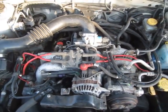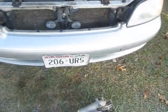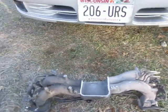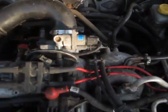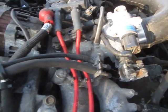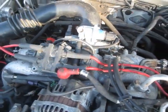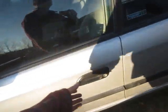And this is what we ended up with. Got a little different air intake. Had to custom make some plug wires. And the main thing was I had to take the 2.5 intake and cut where the throttle body attaches, because the 2.2 uses an IAC. And on the 2.5, I don't know if they call it an IAC or not, but they use that, which is embossed into that. So then we had to weld the 2.5 throttle body plate, I guess you could call it, onto the 2.2 intake. And there's a few other little things we had to trick, but I'll fire it off here.